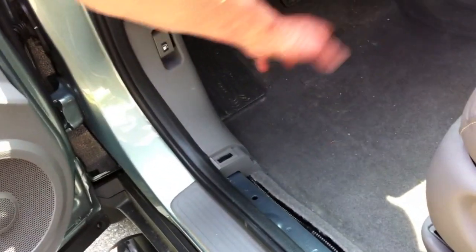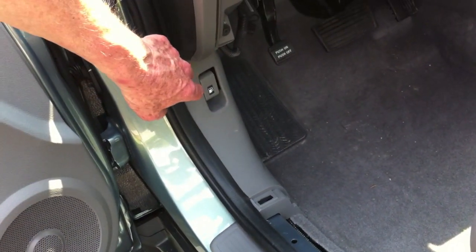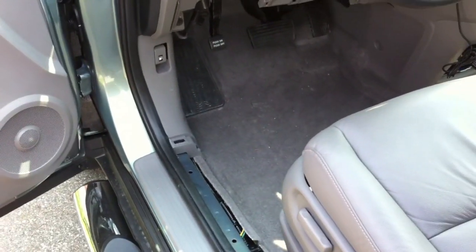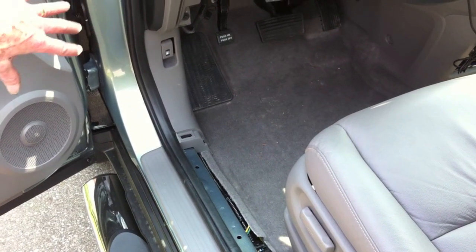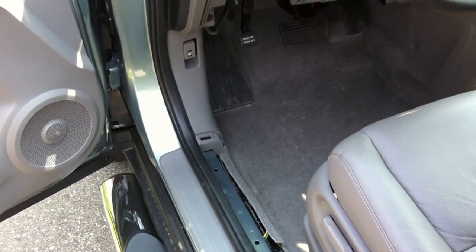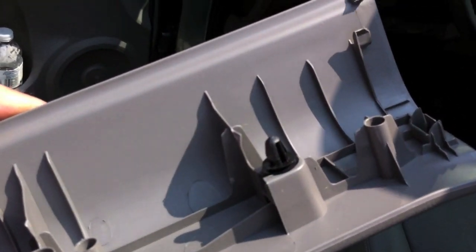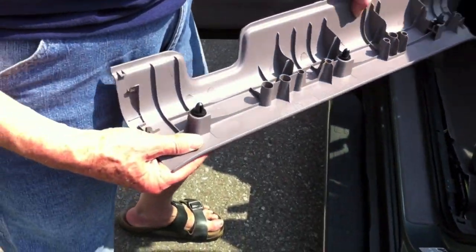This panel also pulls off. In most cases it's just a press fit, pulling towards the inner section of the car. If there is a retainer, there might be one or two push-button type retainers — you usually just pop those out, pulling out the center section, and then pull on the whole unit. In most cases, newer cars today use a push-in pin that just locks the panel in place. There's an example of a push-in pin — you can see it just pushes into place, and that's what actually holds this panel in place on the car.